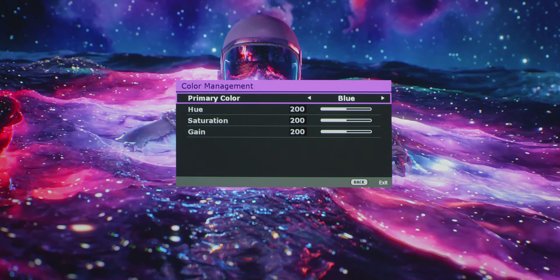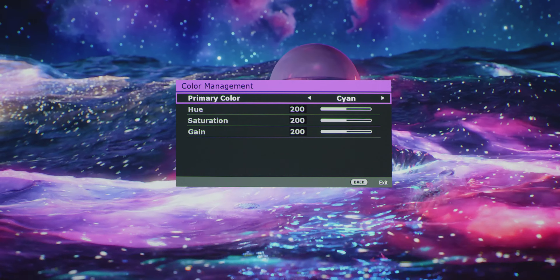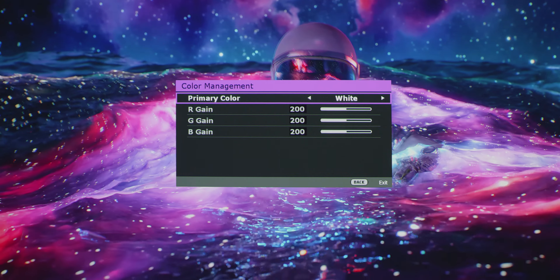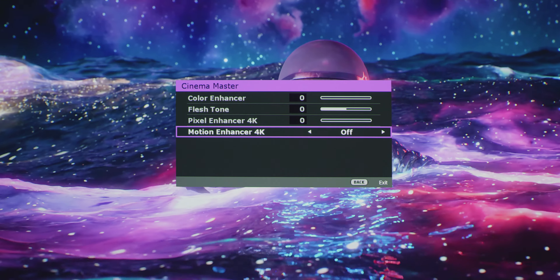For this setup I have the V7050i paired with a motorized floor-standing ambient light rejecting screen from Vividstorm, specifically for an ultra short throw projector. The picture modes it offers are Bright, Bright Cinema, Filmmaker Mode, and DCI-P3. My favorite mode is DCI-P3 because I want the most accurate colors and best contrast — it provides the deepest contrast at lower brightness levels. I also go into the advanced tab and set the color temperature to Normal for the most balanced white coloring. I set my color management with hue, saturation, and gain all at 200, which is the default value across all primary colors — red, green, blue, cyan, magenta, yellow, and white — to ensure 98% coverage of the native DCI-P3 color gamut. I also set everything in Cinema Master to 0, as a personal preference since I don't want any additional color retouch or added sharpness.